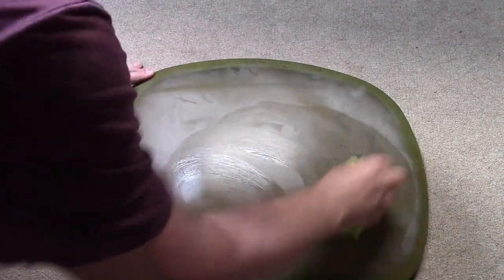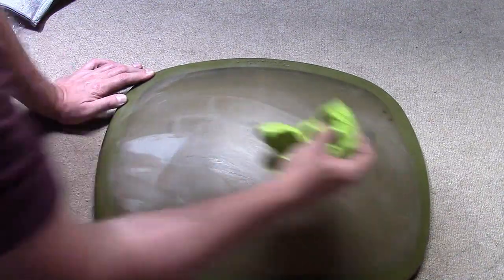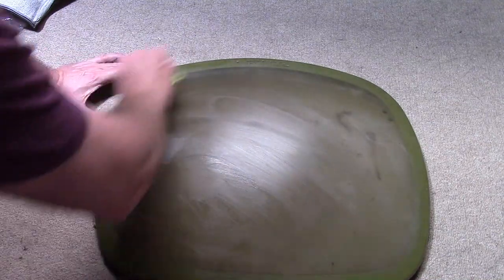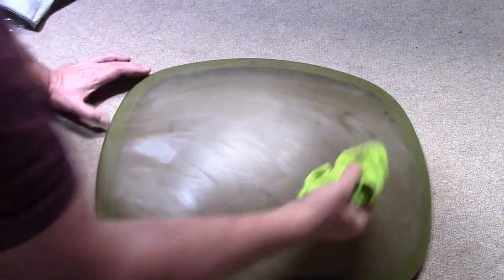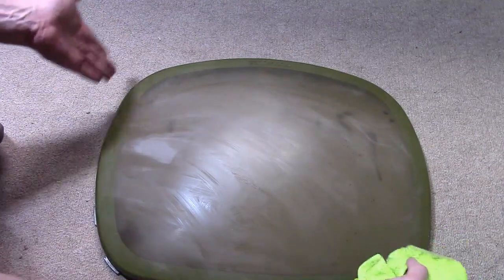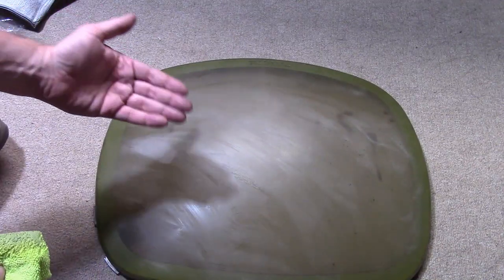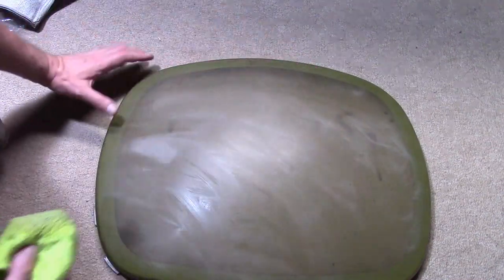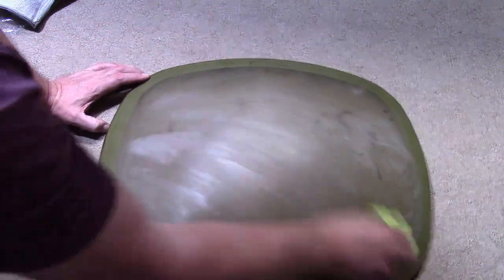This one — I think the interior surface is actually worse than the exterior, which is a drag, because if you want to clean it you have to take it off the set, which is not the easiest thing to do. You can also see marks here — they shrink over time. As they're decomposing, they're also losing volume, and you can notice the really bad ones are visibly less wide and tall than the back cover. But what that also means is they can start touching the glass CRT behind it, and you can see marks start to form. If you adjust the mounting hardware, you can get a little bit of separation back to prevent that.